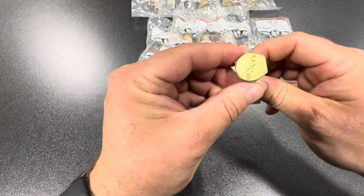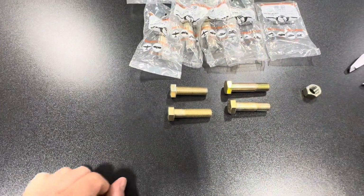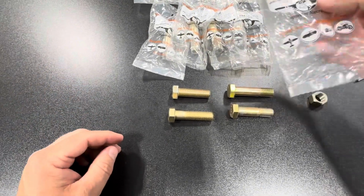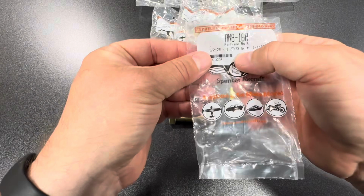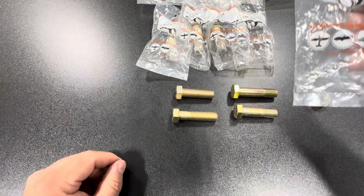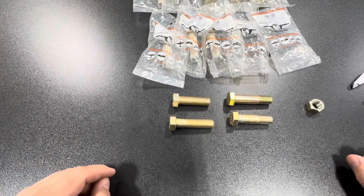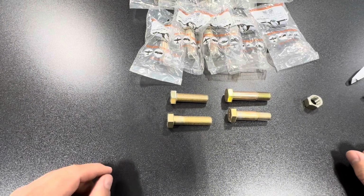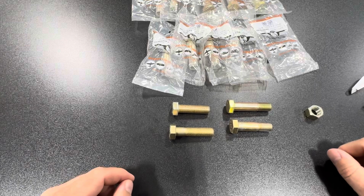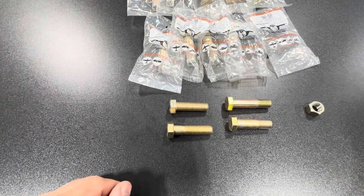This one has an X on the center of the head. Thought that might be a little bit helpful if you ever want to measure the distance between centers on your four-link bar. But other than that, you have quite the variety. You're not going to find small increments like 1 inch, 27/32 on the length with the 1 1/16 grip length at the hardware store. So, finding these and getting the right one set up for your four-link so you don't mess that up and get premature wear, or also consistency issues as that starts to wear out and the slop is going on, while you're launching a car and things of that nature.